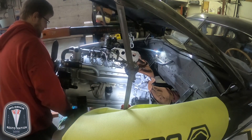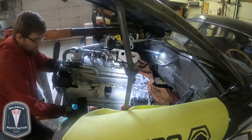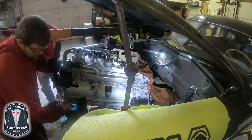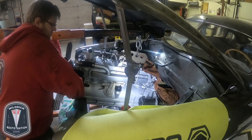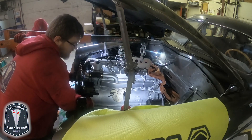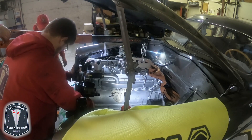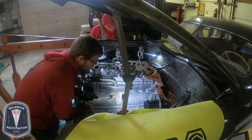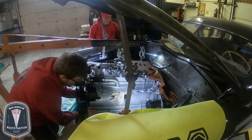Go to the passenger side a little bit — just take and push the back of the engine there. Here we go, we're at the tight spot on the transmission as we discussed. Push it straight back — don't lift it. You're on the hump. This is where the transmission is taller than the gap between the floor pan.